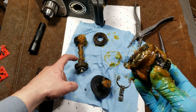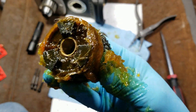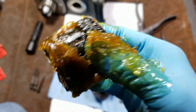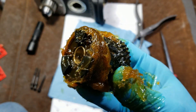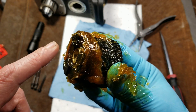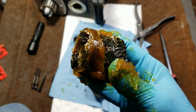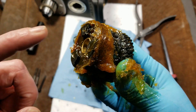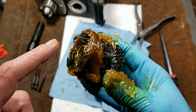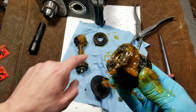This small gear interacts with teeth cut directly on the body of the clutch housing. They used bronze sleeve bearings rather than needle bearings on the clutch — when the first gear clutch is engaged, these bearings aren't spinning; they're just acting as a bushing to keep it centered, so very little wear. When in second gear, this clutch is free spinning with no load on it at all — the output has been disengaged via the dogs.